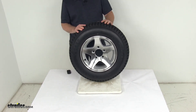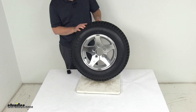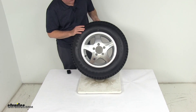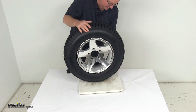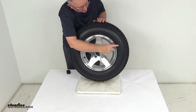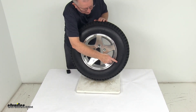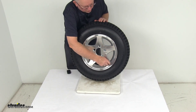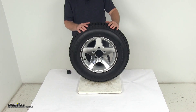Most all new trailer tires now come with speed ratings, and the speed rating is always stamped on the tire with a letter designation. You'll find it right after the size we went over — right next to it and down below — there are two numbers which are the load index and then the letter M. The speed rating M means 81 miles per hour.